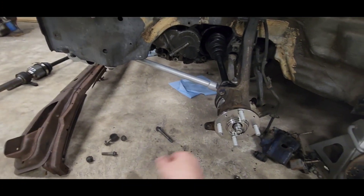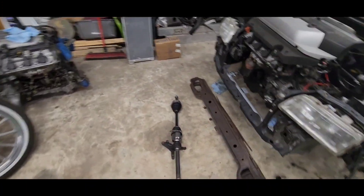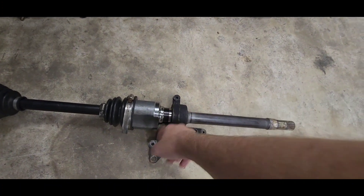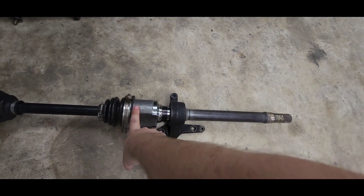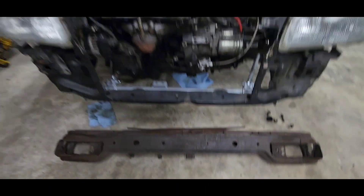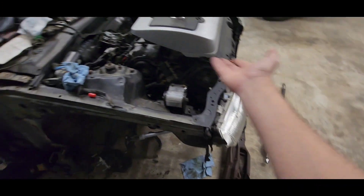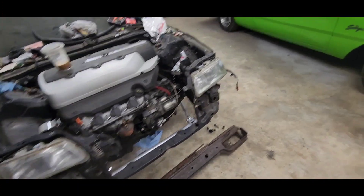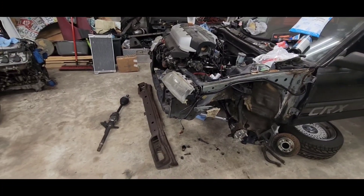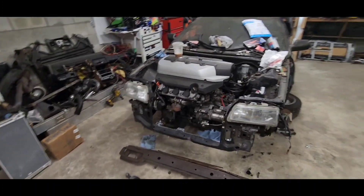I figured this might help anybody in the future doing a swap like this. I assume it would work if you're running an automatic or the 27-tooth — this one's the 29-tooth half-shaft. This is a female and this is a male half-shaft, and it's vice versa for other swaps. I want to say they'd probably be the same, because if these B18 axles fit, then it should fit for other swaps too — for J-series, that is. That's pretty much it. I'm super excited to start driving this thing again. Thanks for watching.